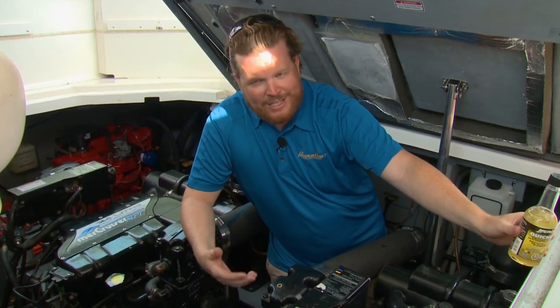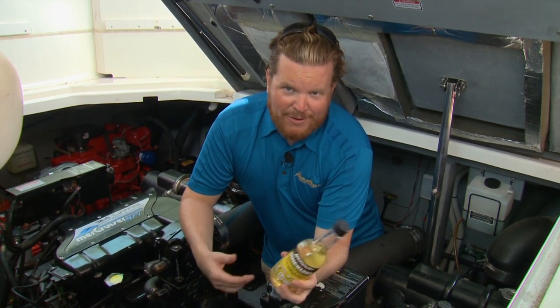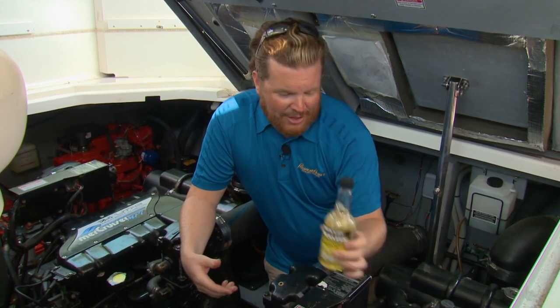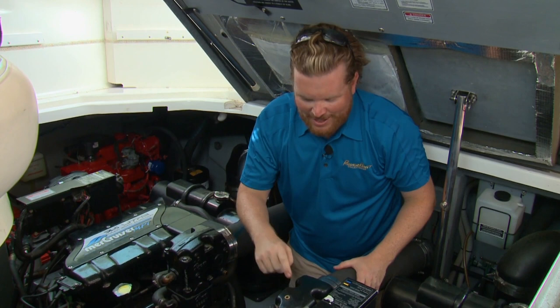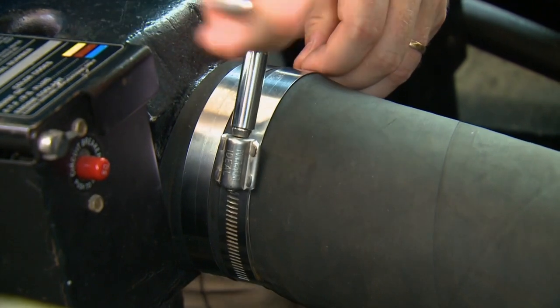Well, the more you do it the better it is — also floss. There's also Mercury Quick Clean, which isn't to be used at every fill up; you should use it at least once a season. This is to remove carbon deposits from everything — carburetors, injectors, cylinder heads — basically everywhere the fuel goes. In terms of what you can visually inspect, exhaust is a pretty obvious one, so this week we're going to show you what to look for, and if you need to replace something, what to replace — spoiler alert, one of my exhaust elbows is pretty nasty.